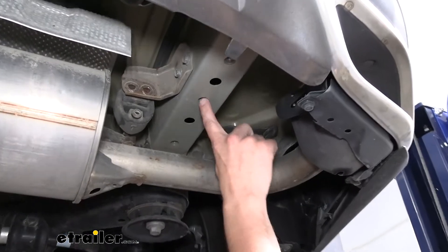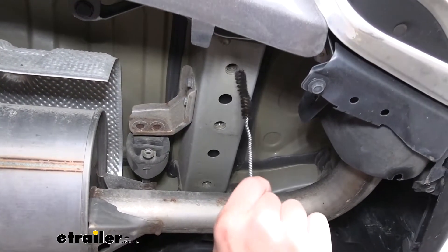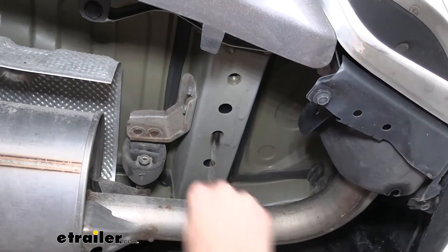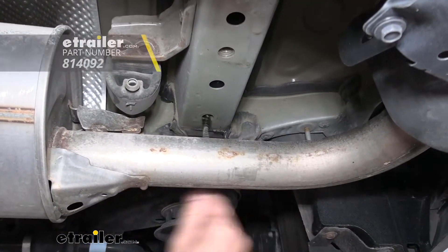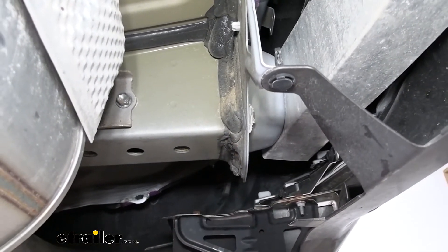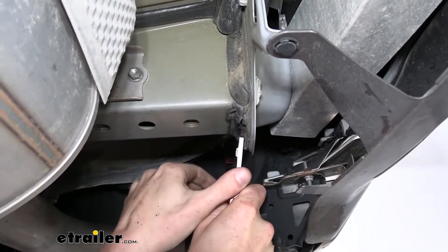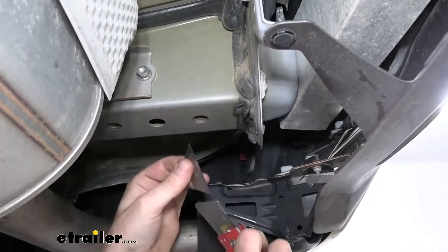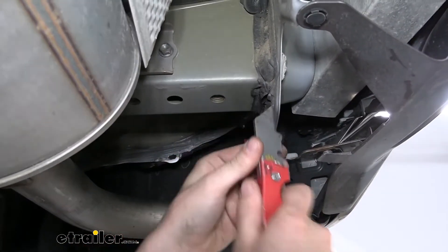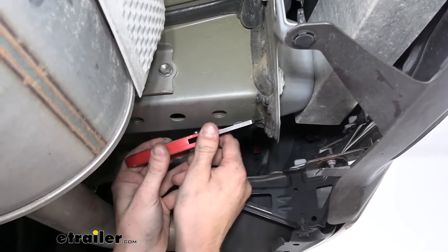We now want to make sure that our weld nuts are cleaned out. You're going to have three weld nuts on each side. We're going to use a little bit of rust penetrant, spray it up into those holes, and then we'll take a bristled brush to get out any dirt, debris, corrosion, or anything else in there that might hinder getting our hardware into place nice and easily. We'll do this on the other side of the vehicle as well. If you need a small bristled brush like this, we sell them here at eTrailer. Now we've got our weld nuts cleaned out. Before we lift the hitch up, you're also going to have some goo kind of here at the back. That can really make it difficult to get your hitch into position, so we're just going to take a razor knife and trim some of this off, and that will allow us to more easily get our hitch into position. We'll clean up the other side the same way because it really does make a big difference in how easy it is to get your hardware installed.